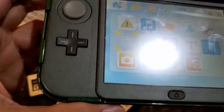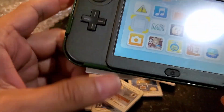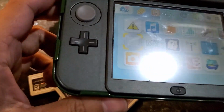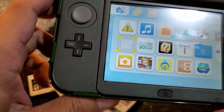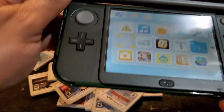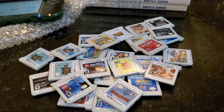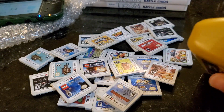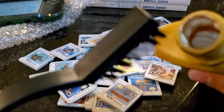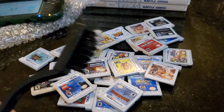Alright, so you can see there, you can hear it click. Smash Brothers is not being picked up. Oh wait, I saw it. Bad contacts. So let's go ahead and clean this one also. We'll do the exact same thing we did with the Mario 3D Land. So we'll get our Brasso, like I told you guys earlier. Get a little bit on there. That's a little bit too much, but whatever.